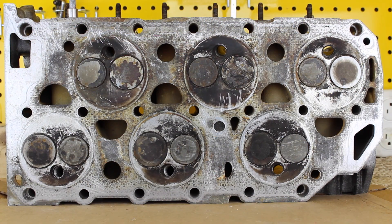Here's the bottom-end view of the cylinder head. Just like the block, this cylinder head has seen better days. You can notice that the intake and exhaust valves are right next to each other. This one has bigger intake valves than exhaust valves; in the 4-valve design they're all the same size, though the length changes because of placement in the cylinder head. It's a flat cylinder head — the valves actually stick out just a little bit past the deck. The exhaust valves protrude a little more than the intake. It's a very cool design, and it makes a great exhaust note and intake sound.